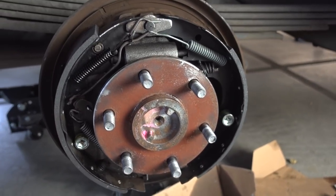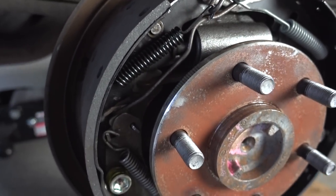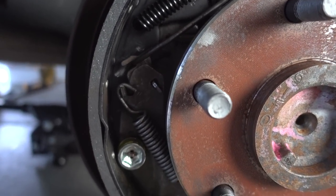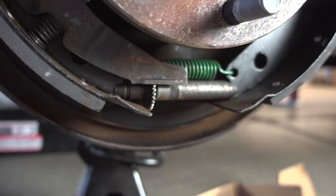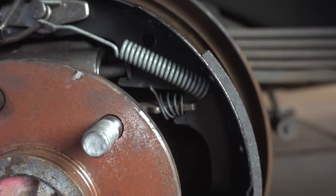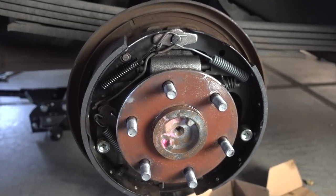Here is the finished passenger side. I'll get up close so you can see all of the springs and the placements — maybe where they go, in case some of you are wondering which springs go where. That's it guys — that is the passenger side rear drum brake. The next step for me is to take a wire brush and clean off the mating surface here. There's a little bit of surface rust and I'm just going to clean that off and paint it up with anti-seize, so when the new drum goes on, it's never going to seize. I've seen videos like the 1A Auto video with guys beating it with a sledge hammer, but mine just came right off with one hand.